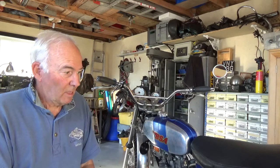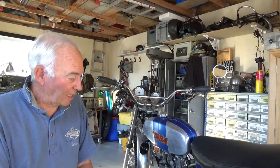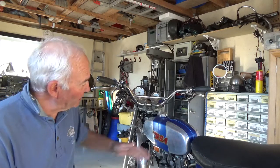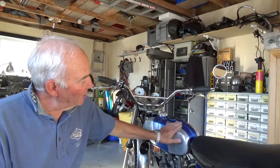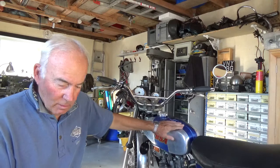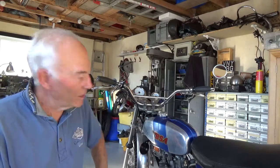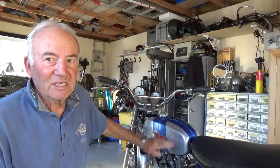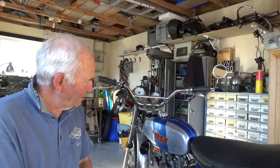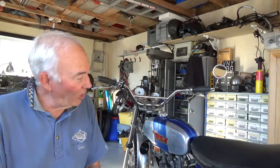We're back on the B50 - she's been out for a few rides and running quite nicely, but I do have a few issues to address. First, a bit of a disappointment: after paying for what I thought was the right stuff, this enamel paint is supposed to be fuel and oil safe. I filled up with the new E10 fuel last week, and where I've spilt, there's some slight discoloration on the paintwork on the tank. Whether it's the 10% ethanol or not, I've never had this issue using this paint before on the Tiger Cub and the C15 when we did the tanks on those.